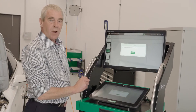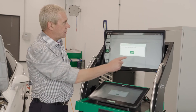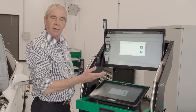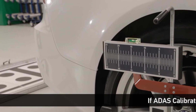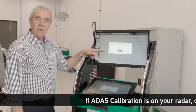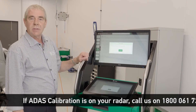We can see that the front camera calibration has been carried out successfully, so we will continue. We do want to calibrate another camera — we need to calibrate the rear camera now. We've positioned the targets at the rear of the vehicle as per the Megamax instructions, so we will continue. Here we can see that the rear camera calibration process has been carried out successfully.